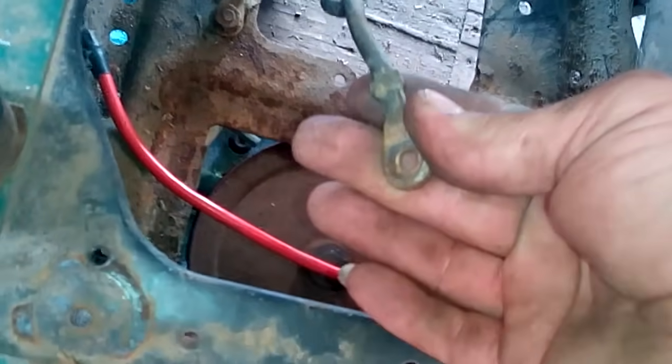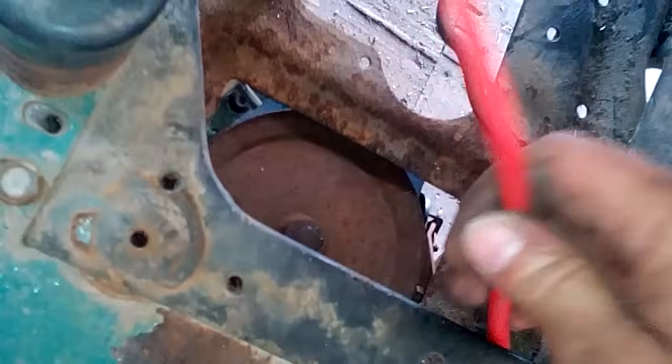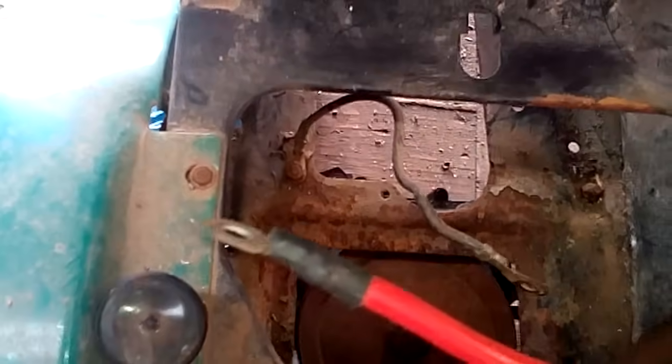Your battery — which is still on the charger — the negative side of the battery goes straight to the frame. The battery side of the solenoid: here's the other end of the wire, it goes straight to the positive side of your battery. And guess what — you're done. It is not hard, it is not difficult to understand, explain, or understand.